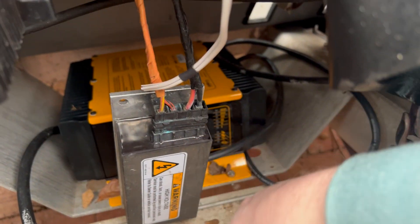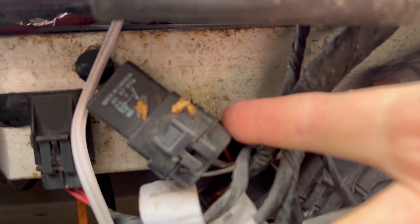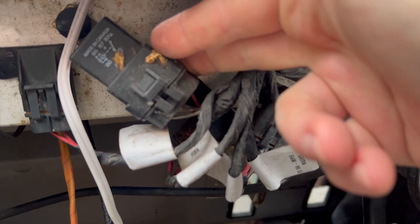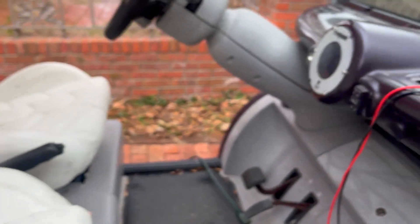If you do see 12 volts coming out but the manual relay test doesn't work, your relay is probably bad — there are actually two relays. I'd advise replacing both. One is for the horn and washers, and one is for headlights and other things. You can feel which one should be activating when you do the test, because sometimes they're not labeled. Your other fuses are also down here. That should be the first steps to get your 12-volt and 72-volt systems going on your cart.